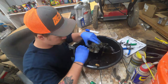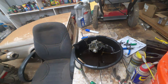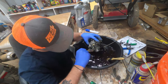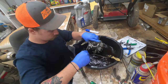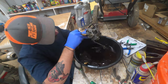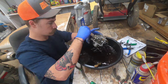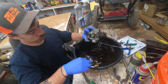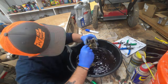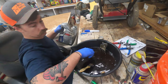Be sure to scrub the throttle plates and throttle bodies pretty good, especially if you're having a problem with them sticking. I cut one of my brushes down — I'll talk about that in a second. Be sure to have a fan or something blowing away those gasoline vapors; there is literature on gasoline vapors causing cancer and it gets you lightheaded. It is an oxygen displacer and also flammable. If you use old gasoline it's less flammable and puts off fewer vapors, so especially with fresh gasoline, have a fan blowing those vapors away from you.